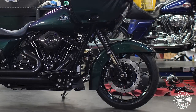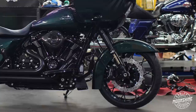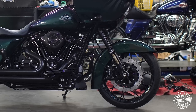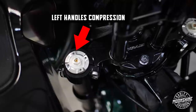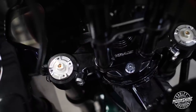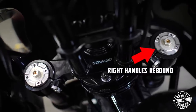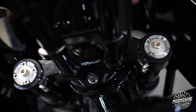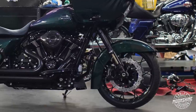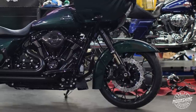Now diving into the Öhlins inverted fork from Kraus — it's similar to what we talked about in previous performance bagger videos with the GP Suspension. Just like the GP, the left leg handles the compression with your adjustment on top of the fork. The right fork has your rebound adjustment on top. Both fork legs have the preload — whatever turn you do on the left you mimic on the other fork so they're set up the same. That allows the fork to work well and the valving to be bigger, with one leg controlling compression and one controlling rebound.